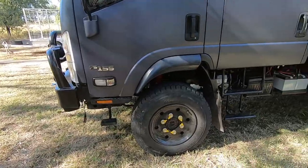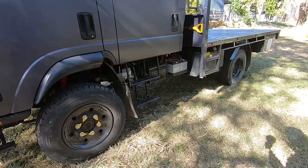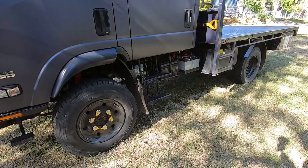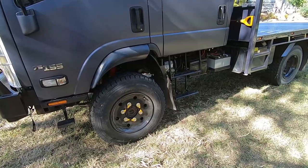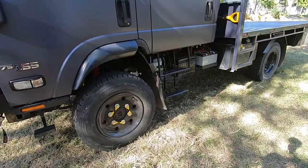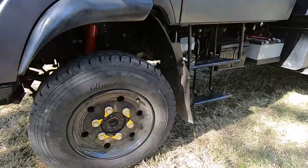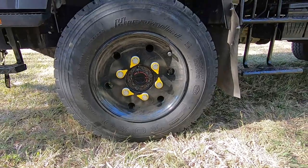It's been modified — instead of having dual wheels on the back it's now got super singles, front and rear. So we've got the correct track, they're both following each other, which is important when you go off road. It's got all-terrain warrior alloy rims, 19 and a half inch, and Toyo M608Z tyres fitted to it.